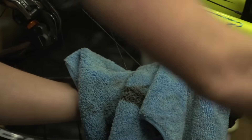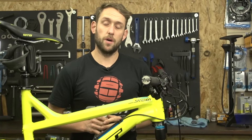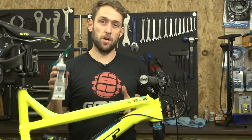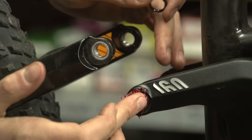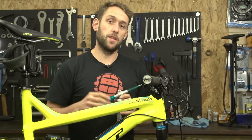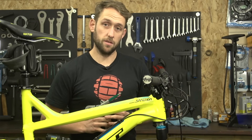Once you're done, simply wipe the excess off. You want to keep moisture out of most of the parts of your bike, and one of the best ways of doing that is using a multi-purpose grease like this. They're amazing for putting in the seats of bearings, either in your hubs or in the linkage of your rear suspension. A bit of grease in there will stop the bearing corroding and hopefully allow you to replace them nice and easily.